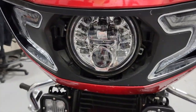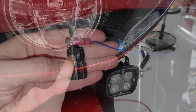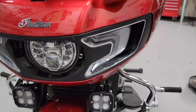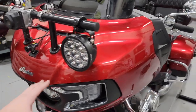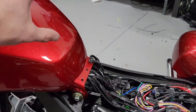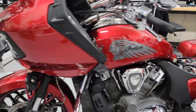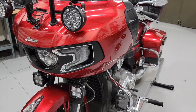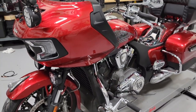A cool tip for the front of the bike: this little chrome bezel on the headlight just snaps right out, and that's how we were able to access both the headlight wire and the horn wire — they're both located right there. We were actually able to do this entire lighting install without removing the entire front fairing. We just lifted up and removed two bolts on the tank, lifted it up, and could do the whole install from there. That should give you a lot more confidence digging into your Challenger.